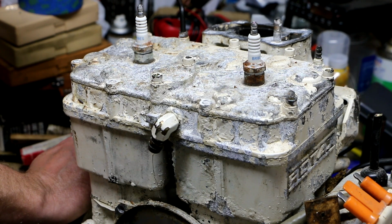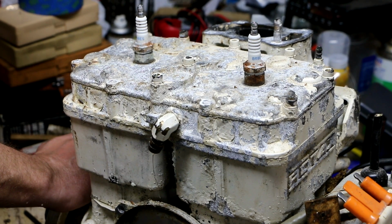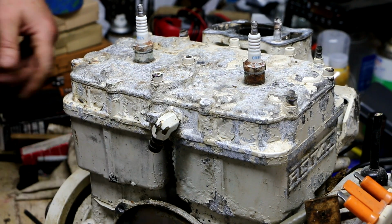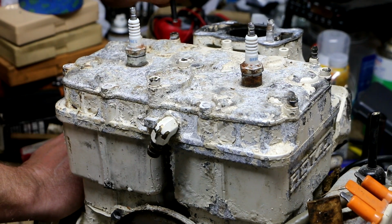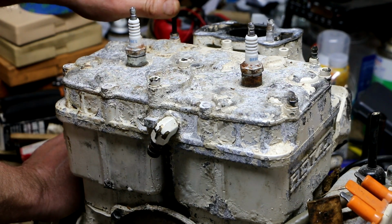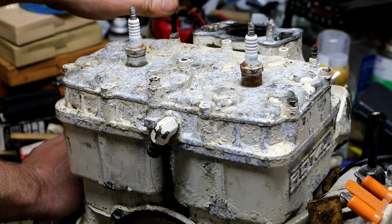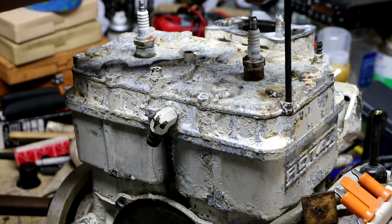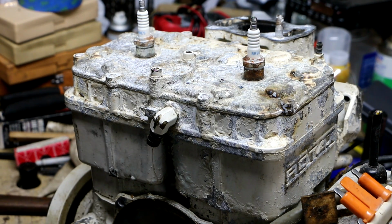So the sound I'm hoping for is a creaking sound, because the creak would indicate that it's breaking free. Just turning a little bit without making that sound makes me think I'm just twisting. Let's see. Oh, that one might be coming. Yep, that's way too much of a rotation. It would have sheared by now if it was a twist. Well, it's amazing to me how far those heads could rotate before they actually snap. That's how much twist they're capable of before snapping.